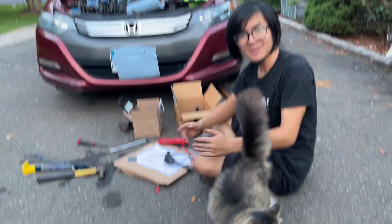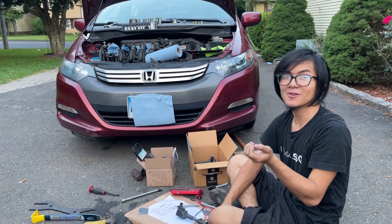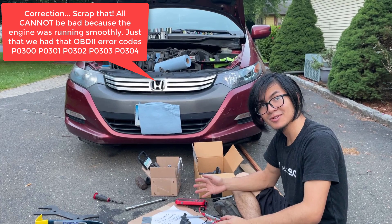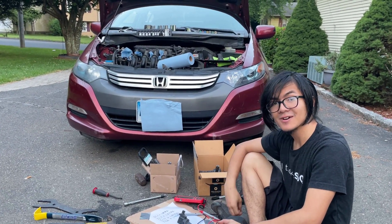So if you can't find a wiring diagram, our method should work. It's either consistently good or consistently bad, and this should lead you to find if one, two, or three ignition coils are faulty.